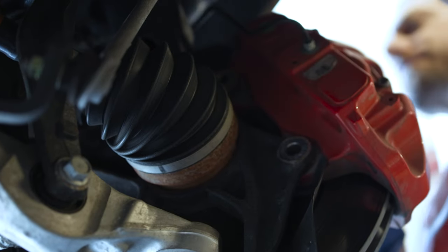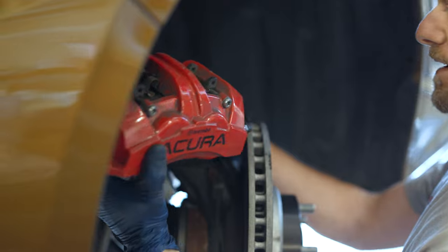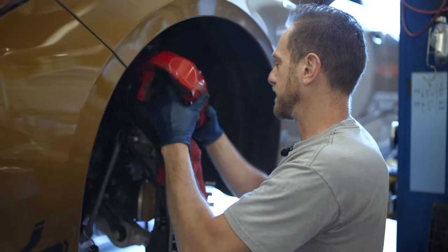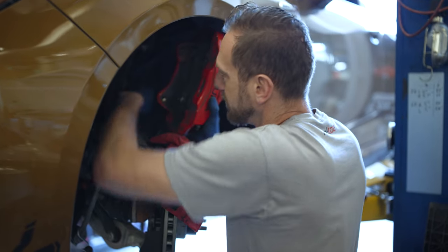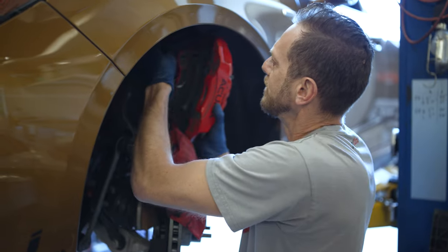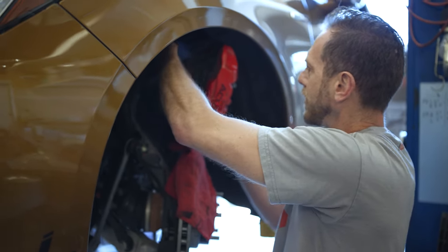What you can do is once you have it unbolted, you can feed the hard line back into the bracket and give it a little rotating motion, then get a rag. You can actually just set the caliper right on top of the rotor heat shield so it doesn't get scratched. To do the service you'll want to use a bungee cord of some kind — just try to suspend it. If you get it bungeed up and hang it off the control arm or something.